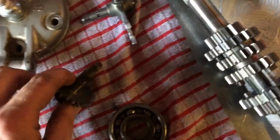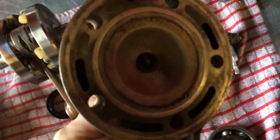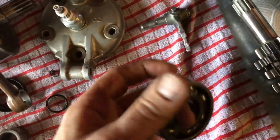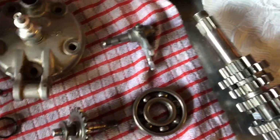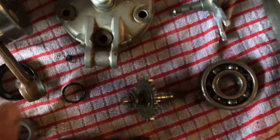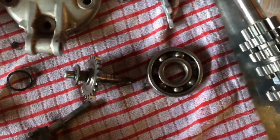But no, for me, wherever this has been, you missed that on the barrel. Wanted a bottom end rebuild, really. Definitely wanted a bottom end rebuild. Places are putting clutch plates in, and a couple of new seals here and a new piston, and it's just not fixing it, is it? It realistically wants quite a bit of work, to be fair.